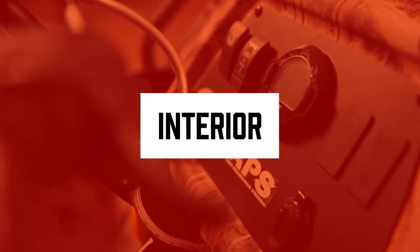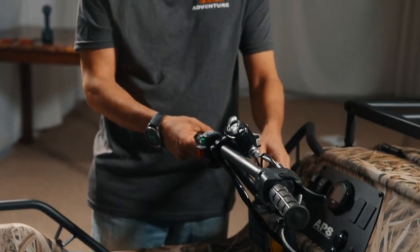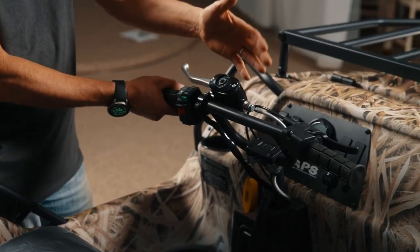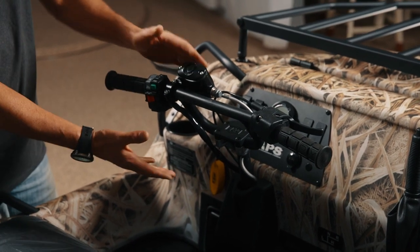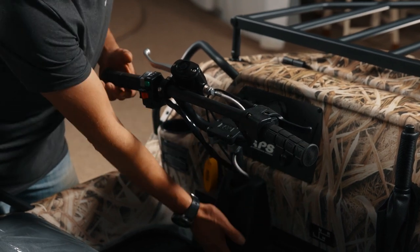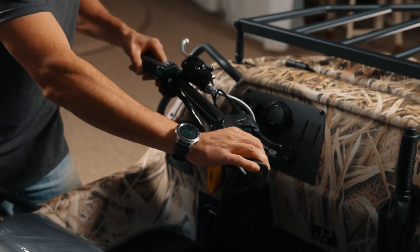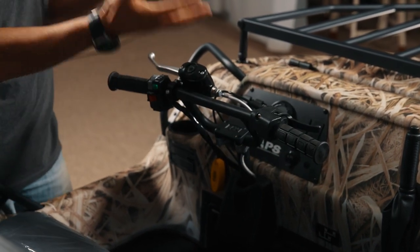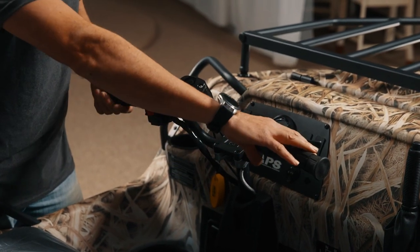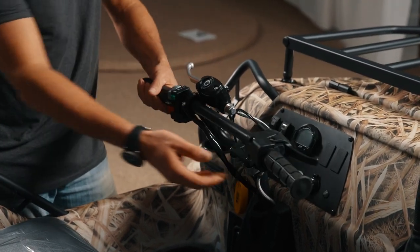On the interior of the vehicle, we'll start off with the Argo Progressive Steering — that's the APS. Hayes Brake designed the steering for Argo. They have a spring assist down here under the firewall for when you turn the handlebars — it kind of springs one way or another. It just takes the effort out of it. It doesn't feel like you're braking nearly as much as it did on the older vehicles. So that's as far as it'll turn to the right and your left — that's your actual movement of the handlebar.